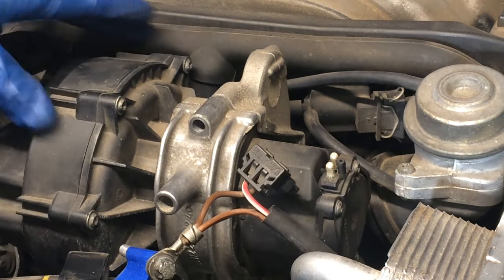There's that little fastener and we can pull this up and around. You can always undo the electrical if you need more room, but I think I'll be good. Looks like this hose probably does legitimately need replacing. I'll go ahead and disconnect it anyway and then I can take it to the parts shop to check the size. I'm just going to give it a little encouragement here — nothing too aggressive because that's a plastic fitting on the MAP. Okay, looks like it'll come off now.